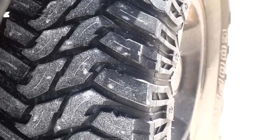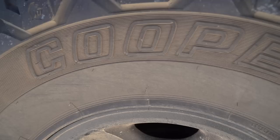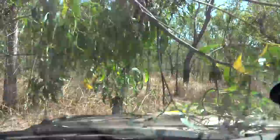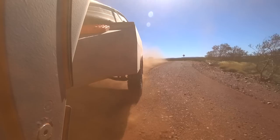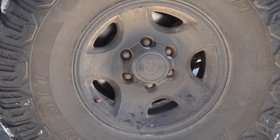The vehicle is purpose-built for beaches and bush driving, where the setup works really well. On the highway, they're restricted to 100km/h anyway because of the trailer. They cruise around 90km/h at roughly 2200 RPM, which is acceptable given the tyre size. The rims are original Toyota aluminium wheels sprayed black.